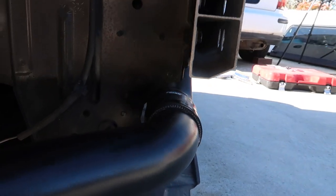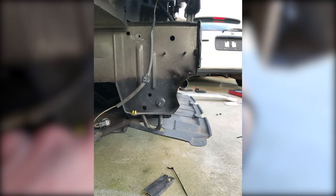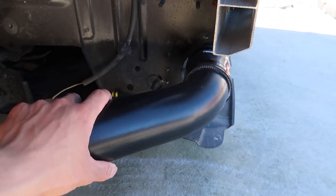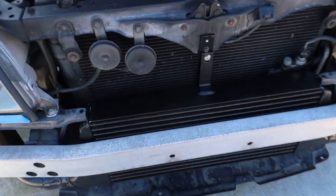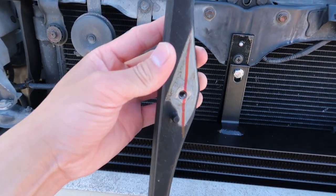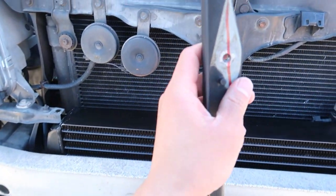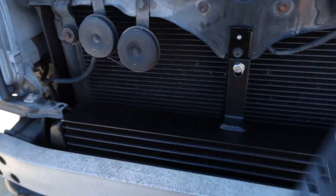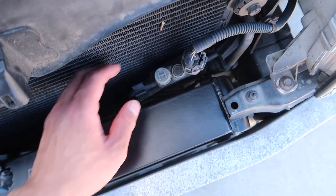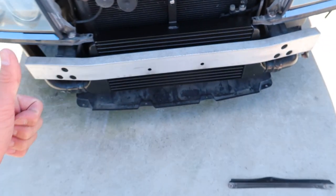It wasn't as simple as that - we did have to do some modifications. We had to cut this piece right here which was basically flat - cutting it allows the intercooler to be pushed back further so you can keep the crash bar on, and it means less cutting of the bumper because it doesn't stick out as much. We also had to modify or make our own brackets at the back for the radiator support and hood latch - the OEM one had a little notch in the way, so we made our own bracket without that notch so the intercooler can sit further in. For the aircon line, I bent the top unit carefully - the bottom one is actually touching the intercooler right now but it still works, so hopefully it doesn't wreck it.